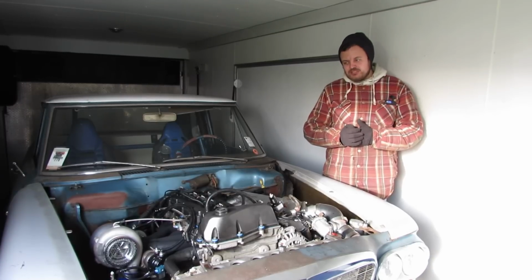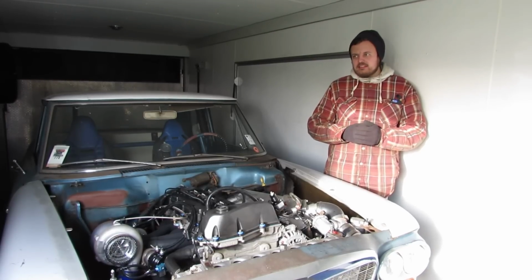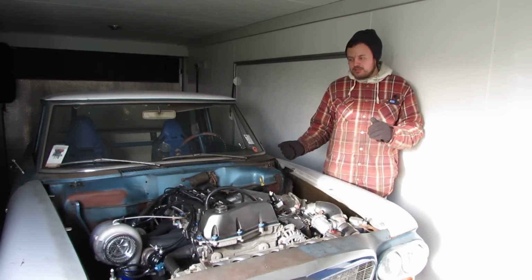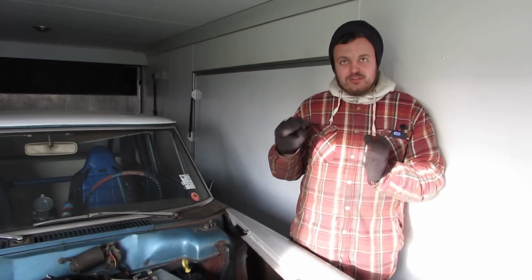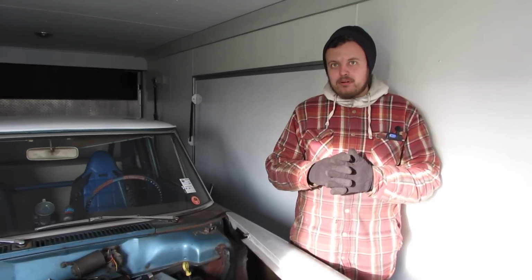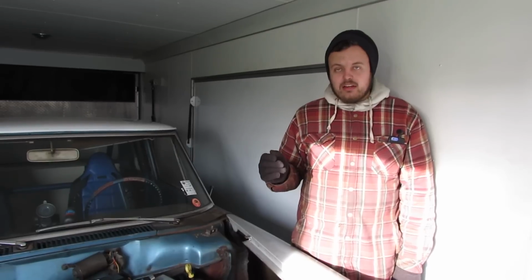So what we saw there was it didn't really pick up a whole lot of power, but realistically, I think a value of around 20 degrees of VVT angle is probably going to be the optimal angle. So that being said, I'm glad we finally tracked that down. The engine responds so much differently with proper VVT control. The only issue is it doesn't like to idle if you give it too much angle.